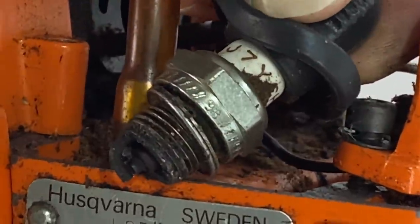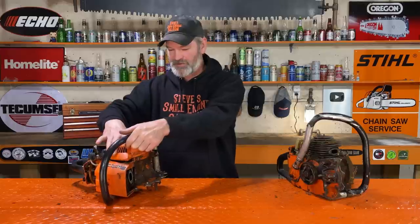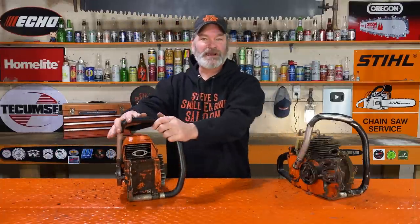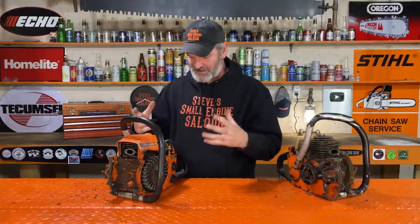It's grounded right there — watch this. It's beautiful. Can't get better than that. You know what, I'm not even going to test that one, because I don't care if that one has spark or not — this is the one we're starting with. It has a wicked good spark and that's what we're going to roll with today. So this one has great compression. On the next episode we're going to test it properly so we can see exactly what it is — is it like 90 or 120? This one has spark, it has good compression, it has two rings on the piston. Everything looks good. The crankshaft — I can't wiggle any of this back and forth, it feels tight, it feels like a nice smooth chainsaw. I cannot wait to get one of these old chainsaws working so I can show you it cutting wood. This is going to be awesome.